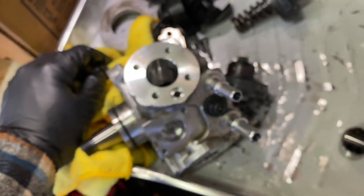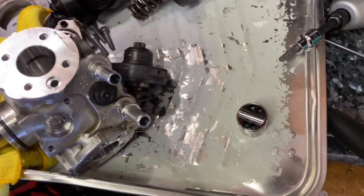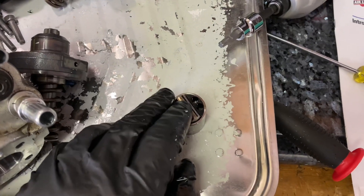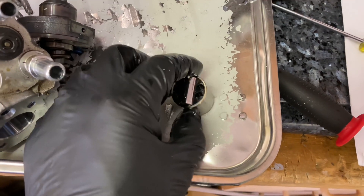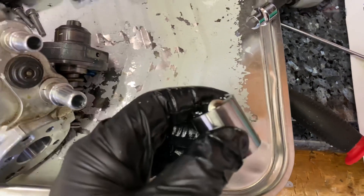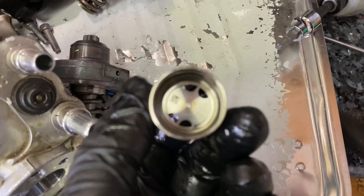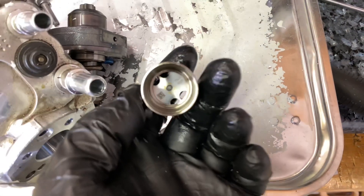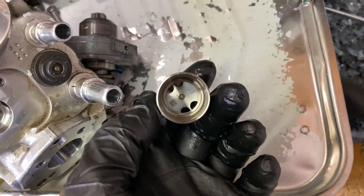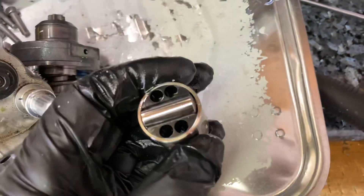There was no issues but there clearly was some scarring on that internal lobe, and there clearly was play on these. If you have information on why you might want to design that in, I'd be curious to hear it. I understand that things should be able to move a little bit, but I am concerned with the potential of rotation — especially if there's any fuel contamination. If this thing turns sideways, that's a bad day, and I think that's what you're seeing grenade on these things. The manufacturing process is actually quite interesting. I would have felt better if they had some sort of clocking pin for this to hold it in position.